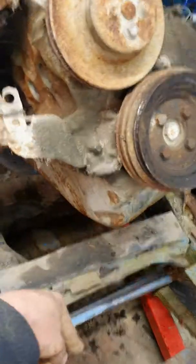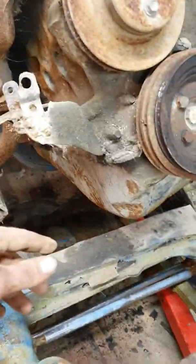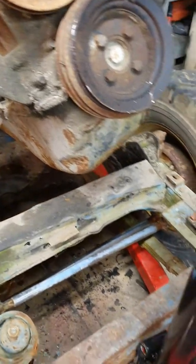If you're wondering why we pulled this motor out - when I drain it, there's oil and then water in the sump. Looking at the dipstick, there's water all the way up here - it's just floating on the surface of the oil. So water contamination is the reason for the swap.